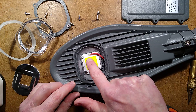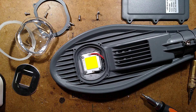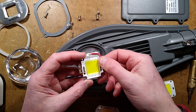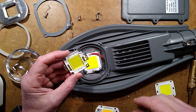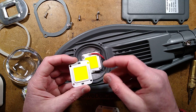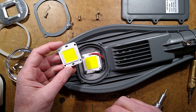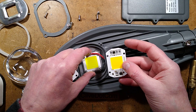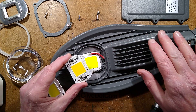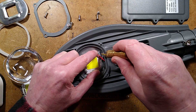I'll tell you what is different - let me grab a couple of LEDs. I'm pretty sure the LED that used to be used in these was this type, and they're notorious for the bonds actually coming off at one end on the bus bar. They moved on to the flip chip style - this is the 100 watt style flip chip LED, 10 in series, 10 parallel. In a way, if you put it in this one it would spread the load over a larger area with less dissipation in the chips. Technically speaking, all you'd need is a live and neutral straight through to this driver-on-board LED.